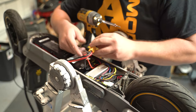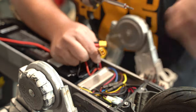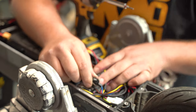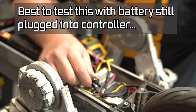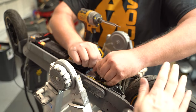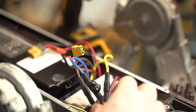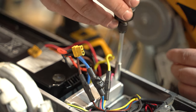Obviously it's not turning on, so we're going to disconnect the cable here. The first thing we're looking at is the phase wires, and you can see they actually melted. A good indication that the controller is bad is if you spin the motor — it should be really hard to spin. In this case it is not hard to spin. Usually in situations like these the connector won't come off easily, so you might have to cut it. We'll upgrade these to MR60 connectors anyway. Here's our melted connector — that's probably the problem right there.